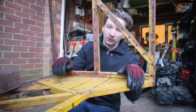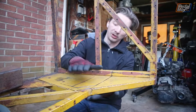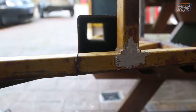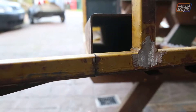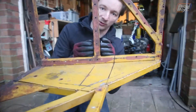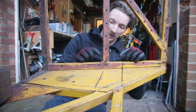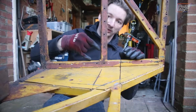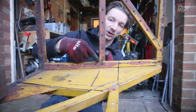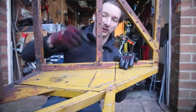Some of the factors we were trying to consider when determining where to put our chassis leg were: how easy it would be to cut the area out, how good it would look alignment-wise — should it be outside or level or inside — and where it should be vertically to meet the engine well. Unfortunately, that puts us right smack bang in the way of this, which is a fairly important part strength-wise for supporting across the back of the car. So what we're probably going to do is take as little as we can out of the end of it here, then fill it in to re-add some of the strength we'll be taking out. We're going to be taking out roughly half of it, maybe even removing the whole thing and filling in later. So we'll cut that out, fill back in at another time, and we should be good.